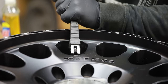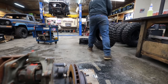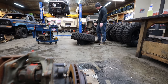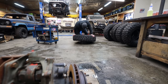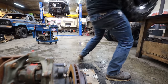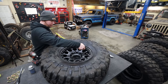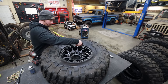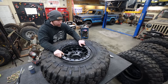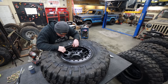The first thing I do is lubricate all of the different surfaces with some really soapy water — I'm talking like a quarter of the container is really cheap soap and the rest is water. Then you've got to drive that inner bead past the outer bead, and I usually just kind of muscle it in there. After that I get it all set up on the table, and I like to blow out every single thread hole — sometimes twice — just to make sure that one grain of sand stuck in one of these threads doesn't ruin your day. You're threading steel into aluminum, so we've got to proceed with caution.